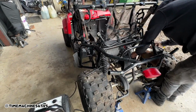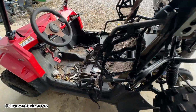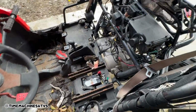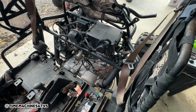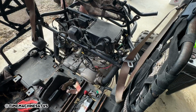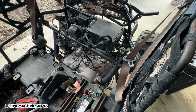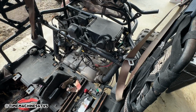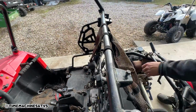So we got this old Polaris back out of the junk pile, and we are gonna run a compression test on it before we open it up and confirm what's causing the low compression. We just want to make sure that our fingers ain't lying to us. Plus, I don't know what these are supposed to run on. Do you? No. Like it might be 90, 100 PSI. That's a Polaris thing. And the throttle's open because the carb's off, so we should just have to crank it.